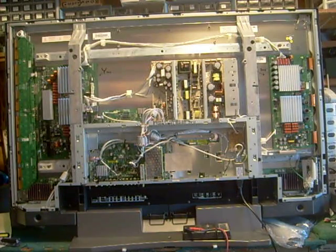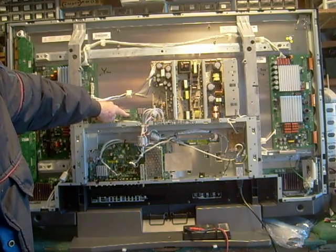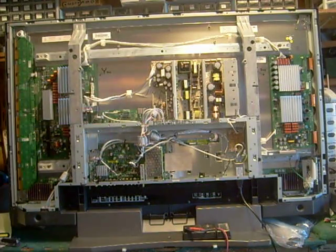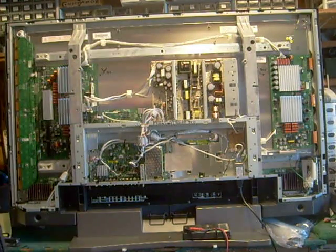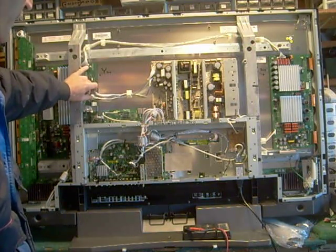The first thing I did was plug it in. I noticed the LEDs on the logic board here came up for just a couple seconds and went right back off. So I checked my power supply voltages, noticed that my VS voltage was completely missing, and the VA voltage tried to come up a little bit but went right back off.